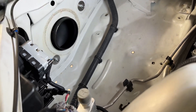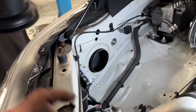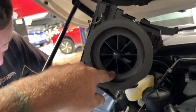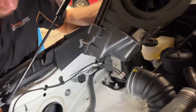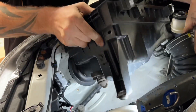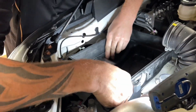Josh has bolted it all in and it's all connected all the way through the snorkel. The next part is to put the airbox in. The airbox has this dangleberry here which is just to disperse water and get rid of it — that is to be siliconed and glued back onto the body to seal it up. There's something spicy coming in here shortly, so we're not going to glue it up just yet. We'll get back to this at another time.